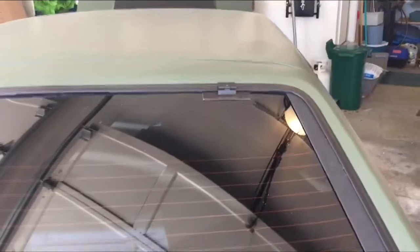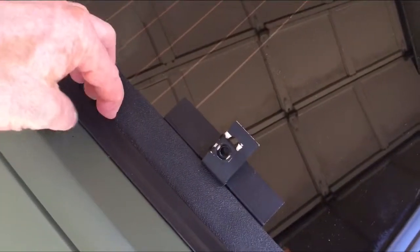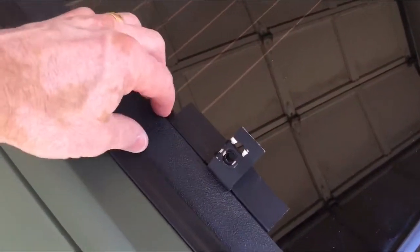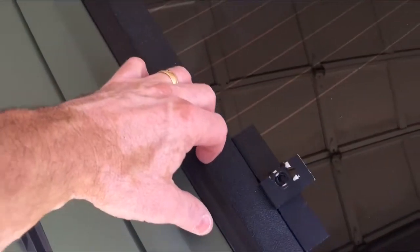And just to continue on the step-by-step procedure, so the hinges are taped on, the brackets are taped on, and I also have the filler plates now. They are also taped on, and everything's in there. So we're gonna wait till tomorrow, see how that goes. And the filler plates weren't too bad to put on afterwards. You may need a screwdriver, and I'd recommend you start from the bottom and work your way up, put a screwdriver underneath, make sure you get some good clearance in there to get these past the lip of the brackets here. And they go on not too bad. And yeah, so there we go. The instructions say that if you put a little bit of soap on the filler plate, sometimes that helps it slide in place. So if you have some problems, you may consider that as well.